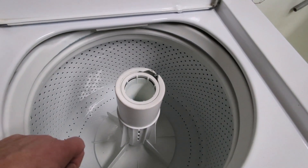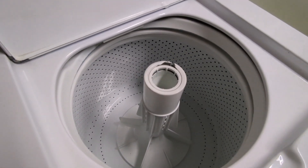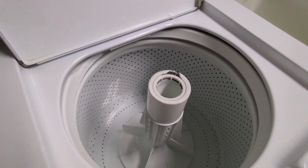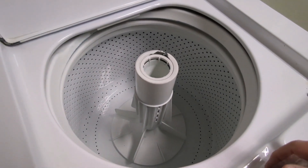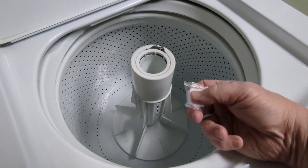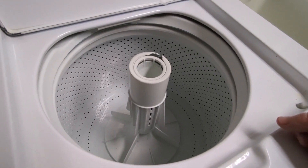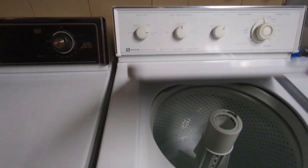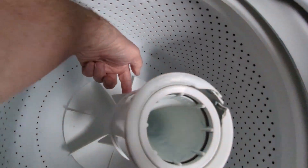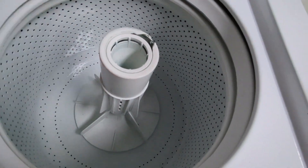We've got to try and get this cleaned up. I was asking a guy a while ago — have you ever used those tablets that you throw in the washer and it's supposed to wash all that mess out from between the drum and tub? As a matter of fact, he does use those tablets. He gave me one and says he uses it about once a month. He says his stuff is all good. I was prepared to have to take the whole top off, get the agitator out — there's a small screw down in the bottom — and pop the whole thing off, though it's been on there for 15 years so maybe I'd have to make some kind of puller to get it up and off.